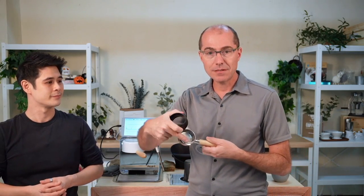One, the gasket can just be getting tired. But if the gasket is pretty new, that probably isn't it. The more common thing is — you'll see Paul every time he takes a portafilter always wipes the top. When you're grinding, especially without one of these funnels, you're going to have probably some coffee grounds there. If you lock in your portafilter with coffee grounds there, you basically jam them hard into the gasket, and coffee grounds are not very watertight, so you have to push really hard to get a good seal.